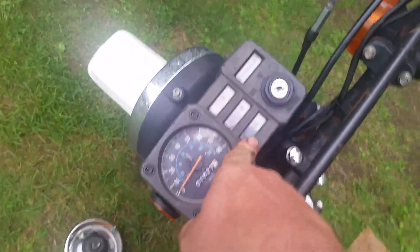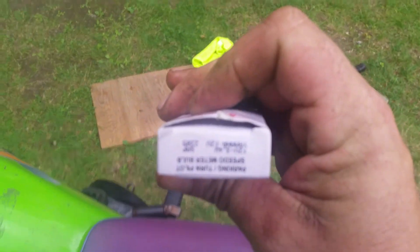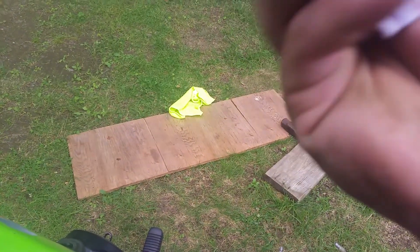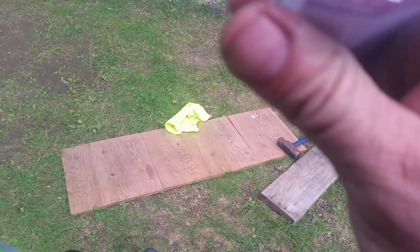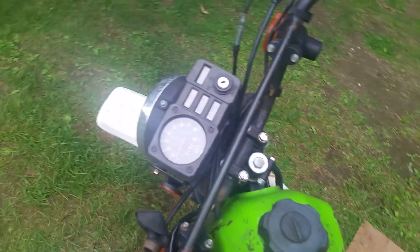In the gauges you've got one for your speedometer, one for your turn signal, one for your high beam, and one for your neutral safety light. Those are going to be bulb number 2205s — you're going to need four of them.